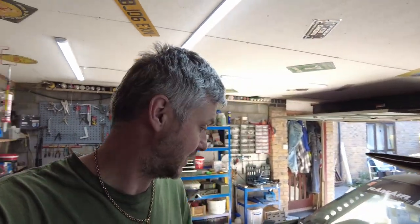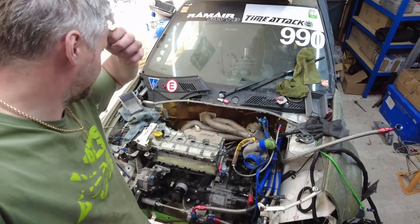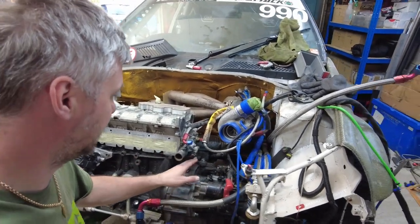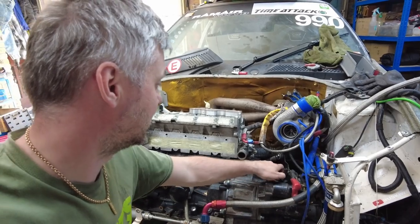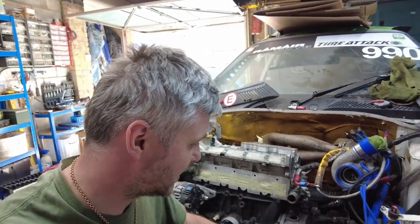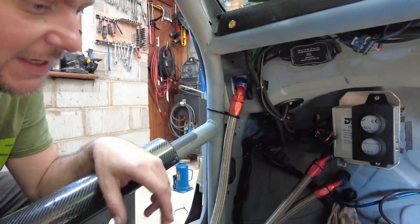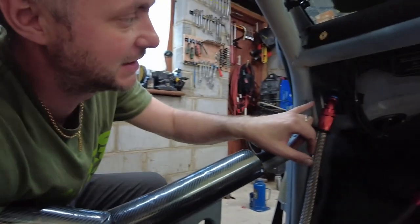The manifold on the blower is on — I just need to tighten some of the nuts on the studs. The gearbox is basically secured, the shifter cables are all adjusted, everything has been checked over and tightened, and I put extra grease on the shifter mechanism. The clutch line is attached, I bled the clutch and it works beautifully. The dry sump hoses are connected, but while doing that I found one of the fittings was leaking — there was a little pool of oil on the floor. So I've ordered a replacement 45-degree fitting from Torques on eBay, hopefully arriving Saturday.